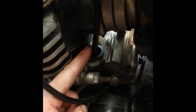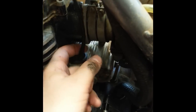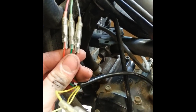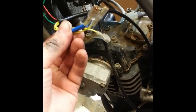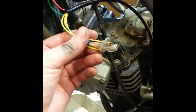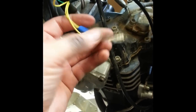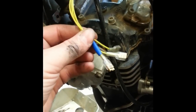I finished running my wires. My stator wiring harness came through the bottom here, up through this clamp. My wire runs up along the frame. I went ahead and made my ignition connections — they're color-coded, so no big deal there. There are different ways to hook up this stator because it can be used on many different models, some that charged a battery and some that didn't. This bike was converted to charge a battery with a single-phase setup, so I may actually go ahead and do a three-phase regulator on here and charge the battery a little better than it was before.